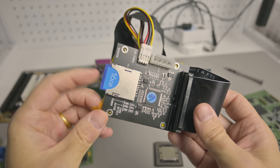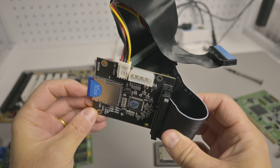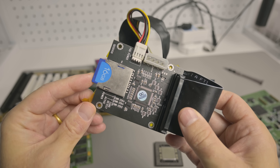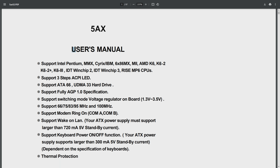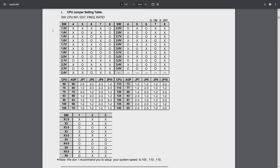For storage we're using an SD card to IDE adapter — they work really well especially for projects in MS-DOS. This is the user manual of our mainboard and it definitely makes life easier if you have access to one of these. On the second page we have a beautiful table with all the configurations possible, and we start with setting the jumpers for the front side bus and the AGP speed, and later we can also do some overclocking.